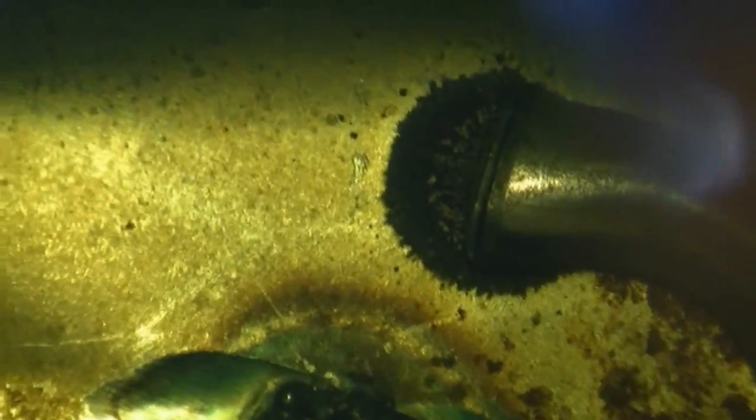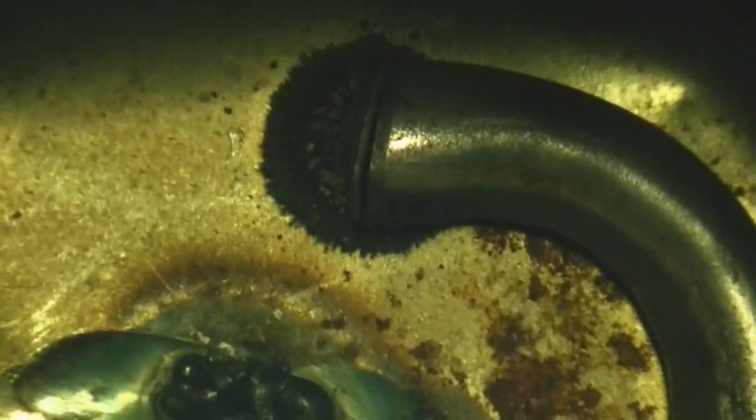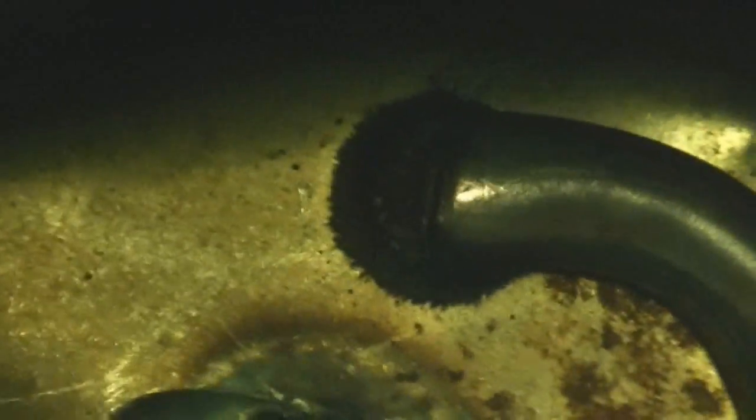Yeah, the reason why I stuck that one right underneath the draw, well, not draw straw, it's not really a draw straw. That is set up for anti-sloshing. It's all inside this little bucket thing, and if you don't have that on there, the only way to fill the bucket would be to have more fuel in the tank than there is in the bucket. So that straw goes, zoom out a little bit. Come on, zoom out, there you go. The straw goes that way and then around to the back.